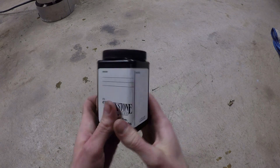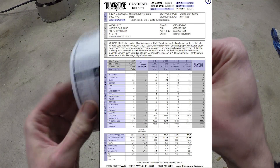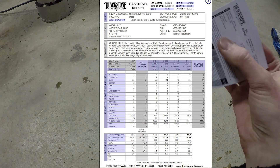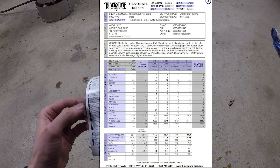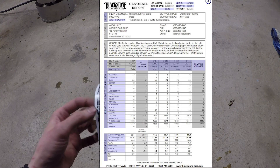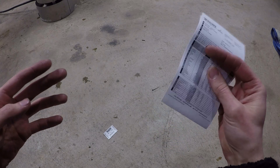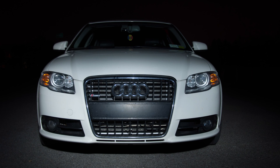In a couple of days you get an email with a report. It doesn't really tell you exactly what's wrong with your car, but it shows the elements found in the oil — things like aluminum, chromium, iron, copper, and other elements. According to which elements are abnormally high, it can point to certain problems with the engine. What we're trying to figure out is what these flakes in the oil are. It sounds like bearing wear and it looks like bearing wear, but we're going to send off the oil for analysis. When I get the report I will put up an updated video. In the meantime, stay warm, check out my other videos, and I'll catch you guys next time.